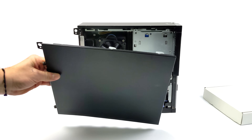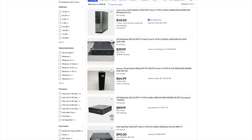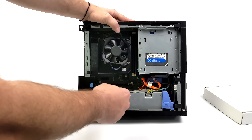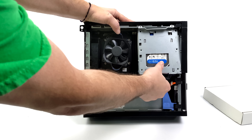For the base of the unit, we're going to be using one of my favorites — an Optiplex small form-factor that has a 4th gen i7. The price on these has come way down, and you can pick them up for under $70 on eBay right now. You could also go with a Lenovo or an HP variant, but I'd highly recommend using something like the i7-4790: four cores, eight threads, up to four gigahertz, and it still performs pretty decently for PC gaming nowadays. The one I have here is an Optiplex 3020, which came with 12 gigabytes of RAM, a one terabyte hard drive, and the i7-4790.